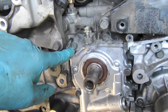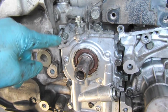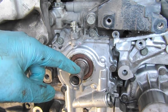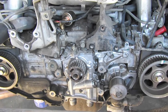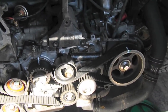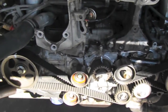The oil pump went in after putting a little bit of black RTV sealant on it — just a real light coat. You don't want this stuff squishing everywhere. I installed the oil seal and the Woodruff key, and now we're ready to install the crankshaft gear. Now that the crankshaft gear is on, let's get the timing equipment back in. What I'm going to do now is rotate the engine two revolutions of the crank, just to make sure all the timing marks line up again.